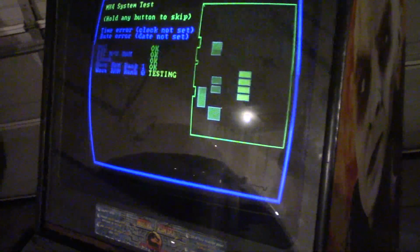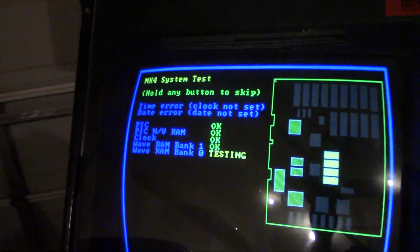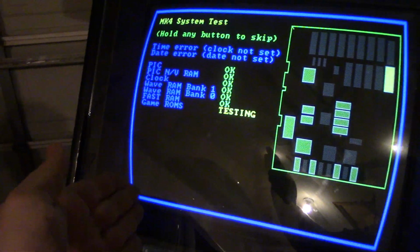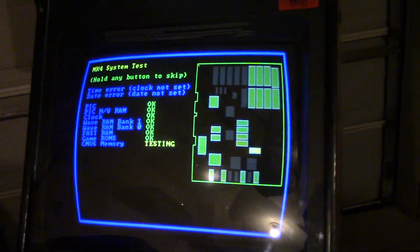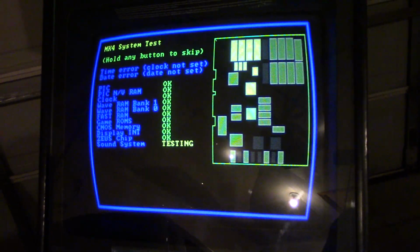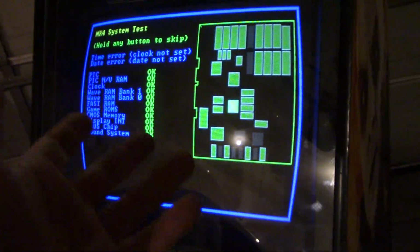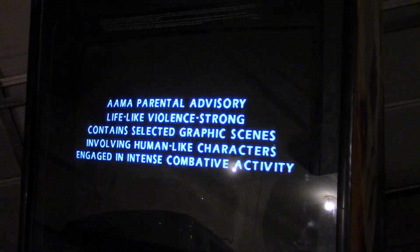So you can see how the image is bowed and not straight up and down and square. You can see how it's kind of curved. That's called pin cushion. So you can see that it's not that bad. I haven't really messed with it. But the monitor is a bit dark. It looks brighter on camera here, but in person it's a bit dark. And the longer it's on, the brighter it gets. So that's the classic symptom of a flyback going out. But it is working,